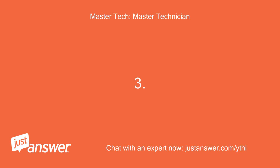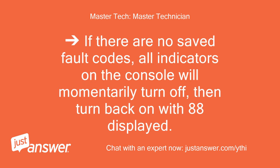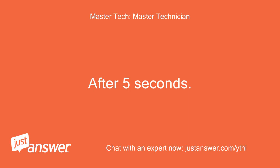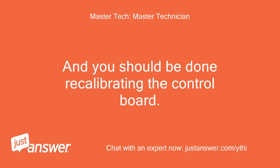3. The test sequence continues by checking for saved fault codes. If there are no saved fault codes, all indicators on the console will momentarily turn off, then turn back on with 88 displayed. After 5 seconds, press the power button at any time to exit. And you should be done recalibrating the control board.